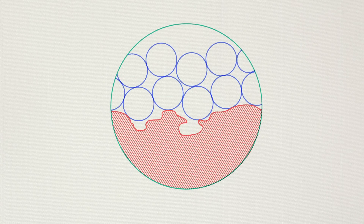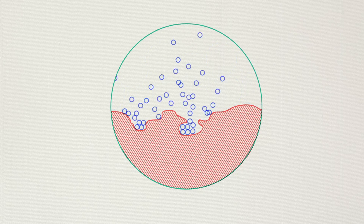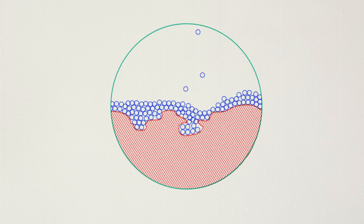Where those big molecules of wax sit above the car's paint to protect it, the molecules in ceramic coating are small enough to stick down inside the little spaces in the surface of the paint. We have ceramic coating particles bonded to each other, trapped in those little holes in the paint, then covalently bonding to the ceramic coating on top as it's applied — effectively fastening the ceramic coating to the paint with millions of tiny covalently bonded anchors.